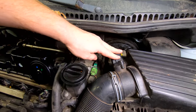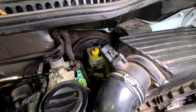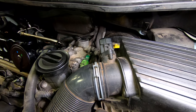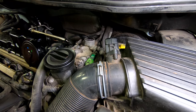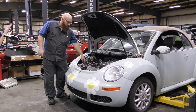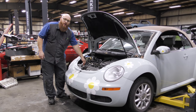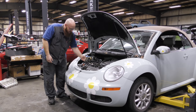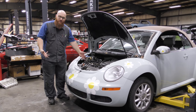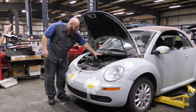Here's the airflow sensor — not pressure, but flow. This was unplugged and the wire was just laying down there. It's very easy to get in trouble as an entry-level tech: there's a code for the airflow sensor, so it needs a new sensor — no, it doesn't. You need to think about what customers do with their cars. You see this big orange ring, which is the oil dipstick? On Volkswagen and Audi cars there should be one inch of vacuum or less from that port. This one was way over one inch. If you pull the dipstick while it's running and the idle goes crazy, you probably have a crankcase ventilation issue — a very common Volkswagen-Audi problem.